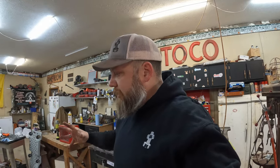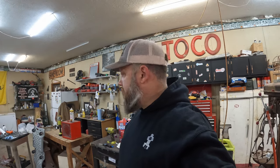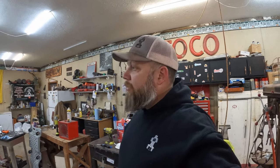Problem for today is to get the interior started on the Cummins, the rat rod Chevy that I built 4 years ago, 3.5 years ago, and never finished the interior. So let's do that. Gotta throw a battery in there. I don't know when the last time that was on a charger, so that should be fun. Also, it's a 12-valve Cummins, so I obviously don't have the grid heater hooked up to warm that intake. We'll see if it starts in these temperatures.